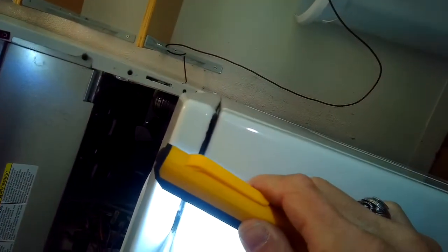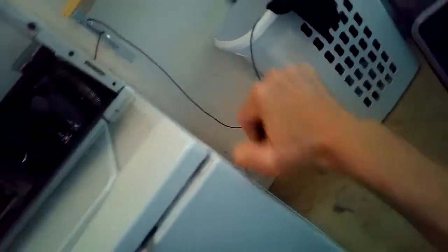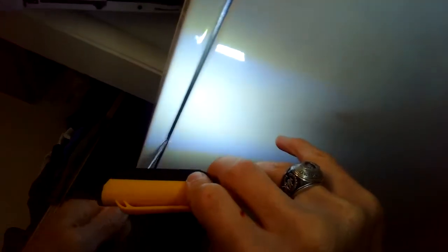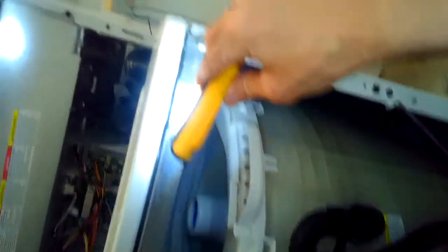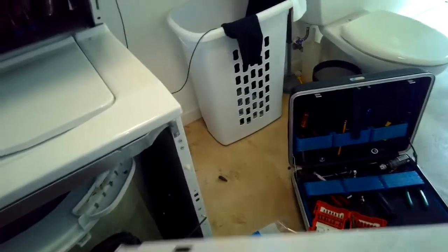This is the panel right underneath the dryer. We'll just pull that off, and then to get the front panel off we're going to put in a screwdriver to push in on the clip and put a screwdriver on the side to give a little leverage, and that pops it out. I'll do the same thing on the left side — push in a screwdriver against the clip — then pull the front plate out. It's connected with a couple of clips at the top and bottom that I lift up off of those clips, and then I have good access to the parts that have failed.